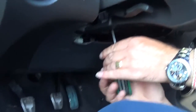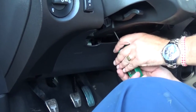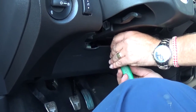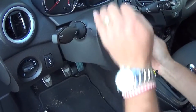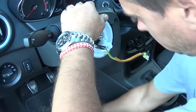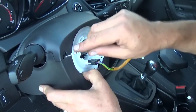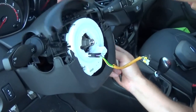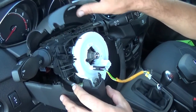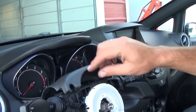Ours is not in good shape. So far we have three screws — the bottom one is actually T20, so make sure you get that right. The ones right behind the steering wheel are T25. Hopefully we don't break any of the trim here. If you grab it on the back, it will come loose and the top will start separating from the bottom piece. The handle for adjusting the column is in there, and the top piece you can just leave in place.